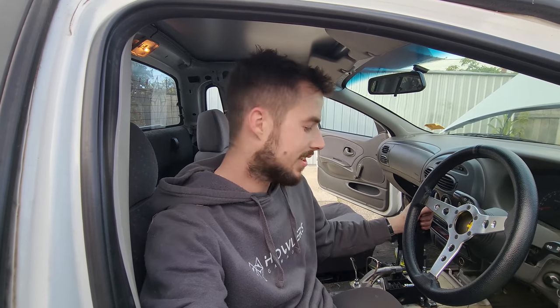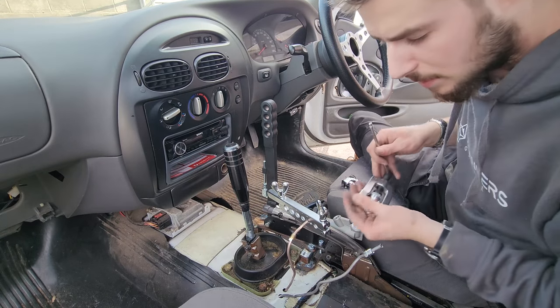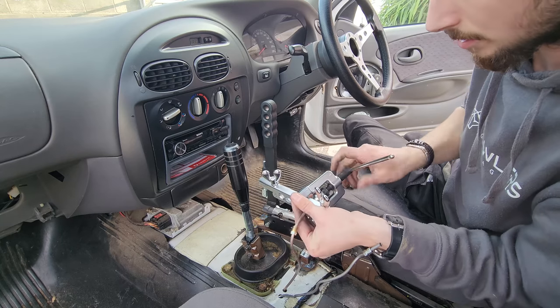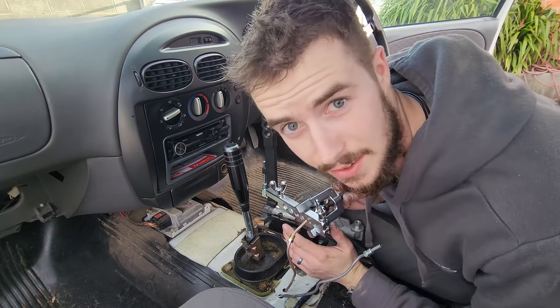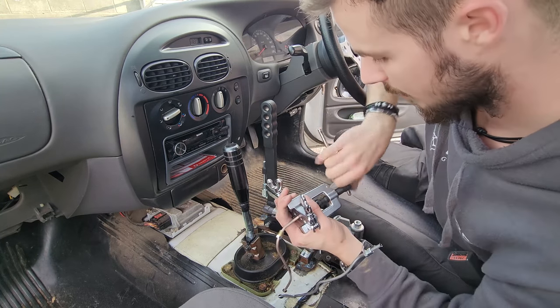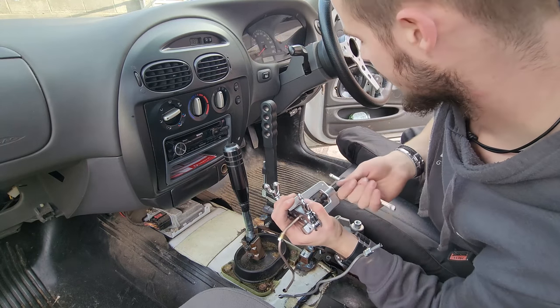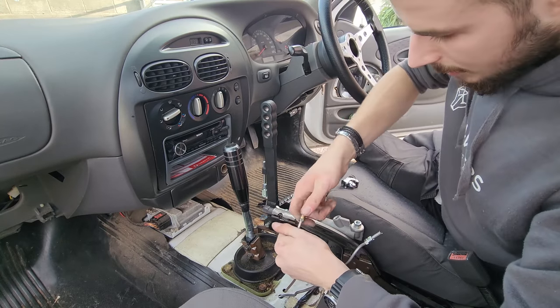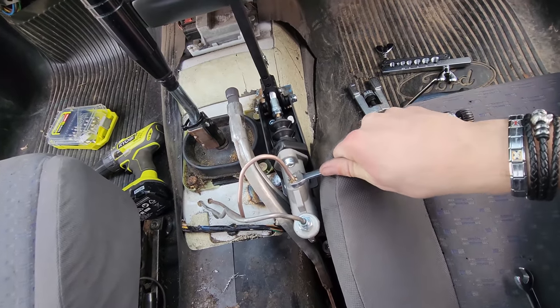Now all we have to do is flare two lines, tighten four fittings, bleed the brakes and there's a hydro in the AU. This is happening guys, this is epic. This has literally taken me from start to finish maybe two hours - it was just welding in this bracket and cutting a bit of steel, and I only had to make one line. Unbelievable. Through all the bad ones I've seen people using on YouTube, buy this one - it just works, it's that easy to flare. Fully flared line.